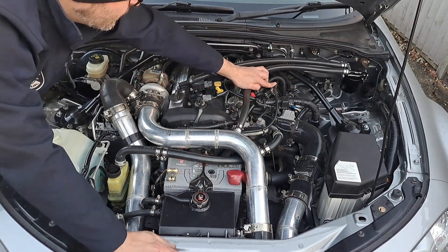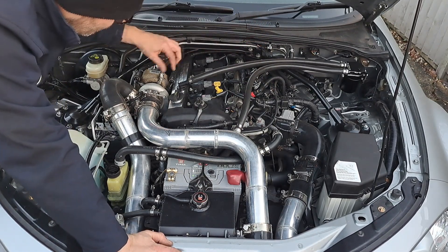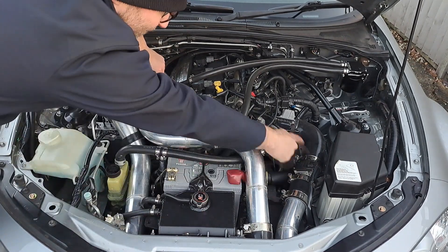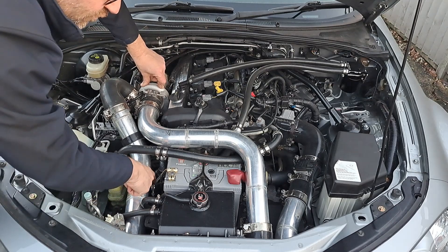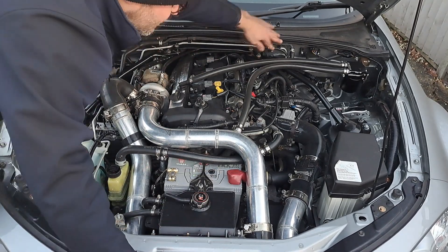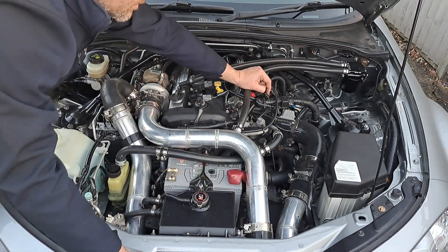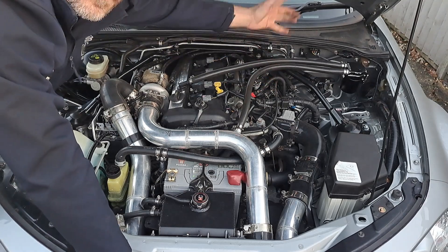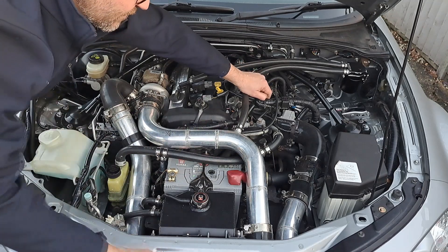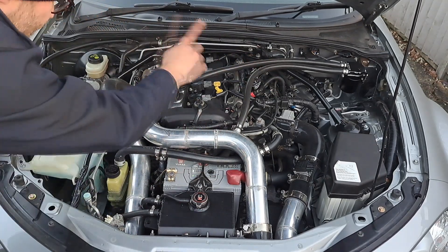The other side of my intake goes through to my boost gauge. If I measured boost here it wouldn't necessarily be accurate because I might have vented some through the blow-off valve. So basically this boost reading is reading exactly what's in the engine — it's taken all the other parameters out. If I'm running 5 psi, it's 5 psi going straight into the engine, with all the other variables removed.